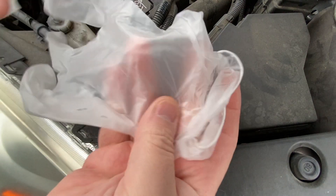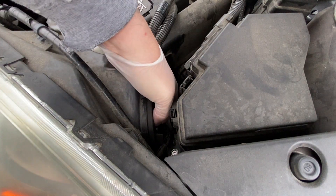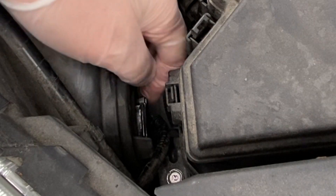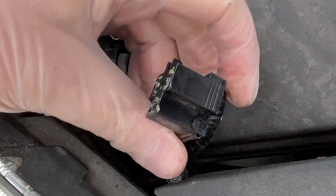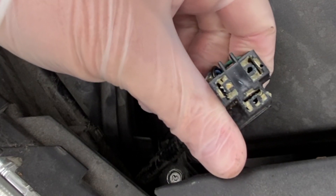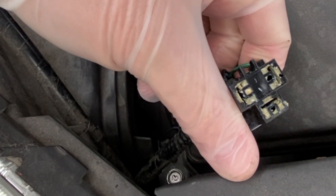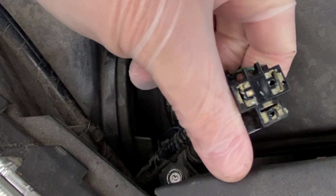The first thing we're going to do is glove up and take this out. You just kind of reach down in here and disconnect the wiring from the bulb. If we pop this off, you can see it's got a good amount of dielectric grease right there. I wiped some off last time, but we'll make sure we wipe a little bit of that out with a toothpick.